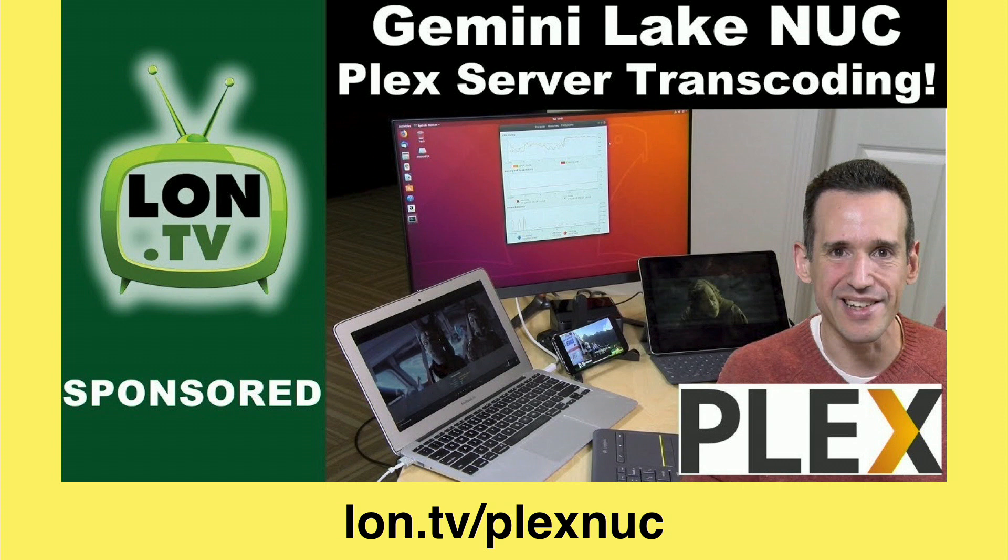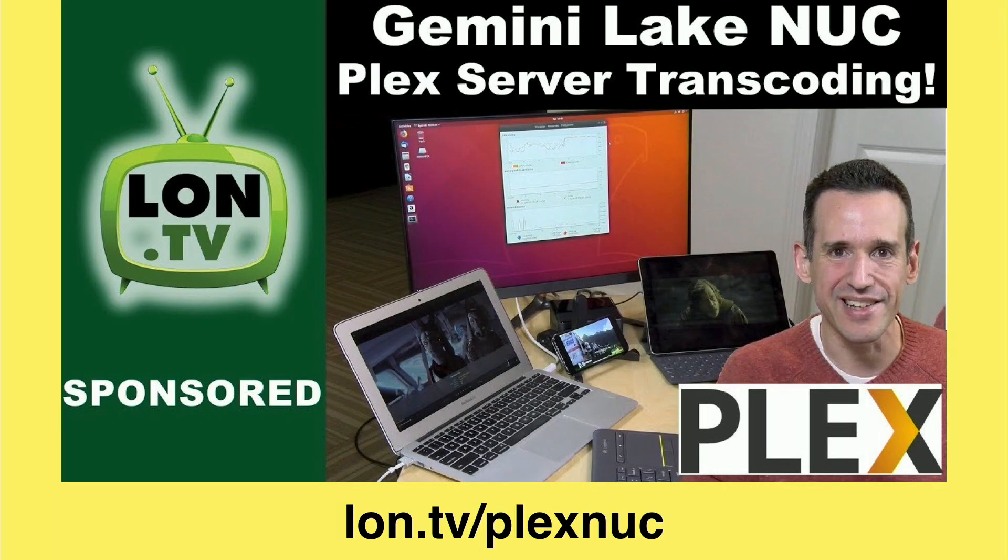Another video, which I'll put down below in the master playlist, will give you some ideas for something a little more affordable. About eight months ago on the channel, we got one of the Gemini Lake NUCs — this is their Silver J5005-based machine. I'll put a link to that video so you can find exactly which one we used. Those cost about $180 and they're a bare-bones kit, so you do have to get RAM and storage, but it is actually able to work just as well as my NAS box does. In fact, the processor is kind of a new version of what the NAS box is already running. We were able to get hardware transcoding on the Plex server side running in Linux, so you didn't even need a Windows license to get it up and running. We were doing three simultaneous streams and still had a lot of room to spare.